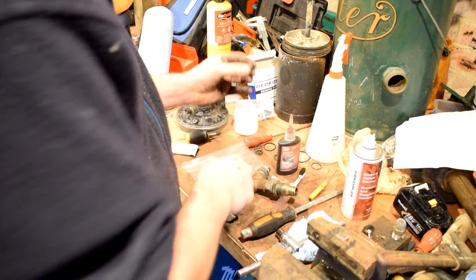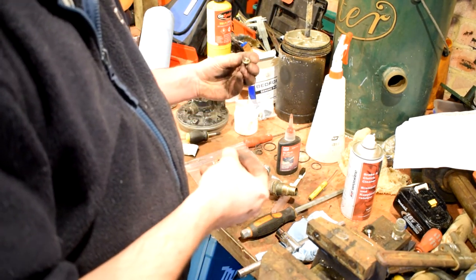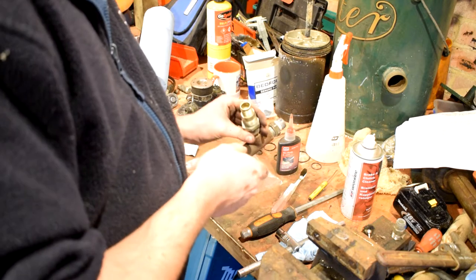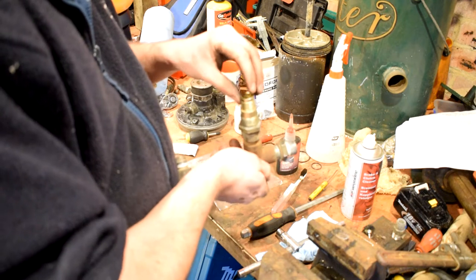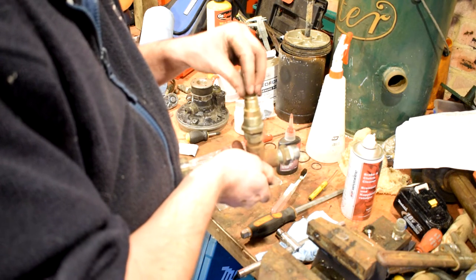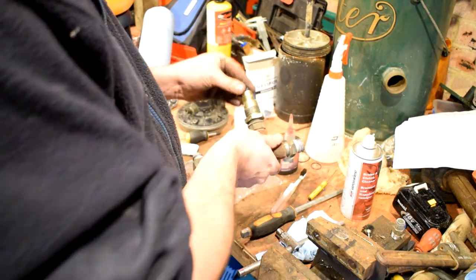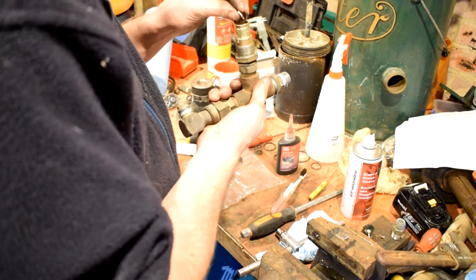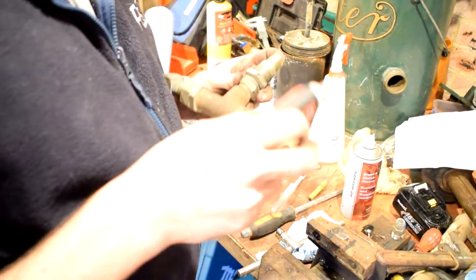Normally it looks like that. Inside it's just simply a little rubber ball, a little spring, and a little cap for the spring. The best way to assemble this: put the cap in there, the spring appears to go either way, spring there, and put the ball on top. You could put that either way to make it work in either direction.